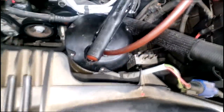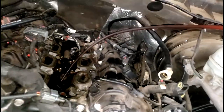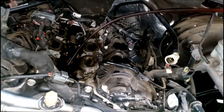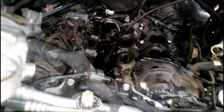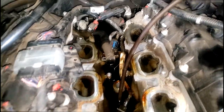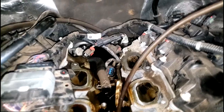Y'all see that fluid? It's coming up out of there and into here. So yes, even then you're still not going to get it all out, but at least I can suck it all out. The goal, guys, you got to get that cleaned up. You don't want the customer or the next oil change guy to think that this thing is leaking again. Remember, it leaks down there on the rear of the transmission, okay? And it can easily look like the oil filter adapter housing leaking again.